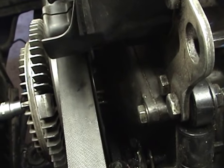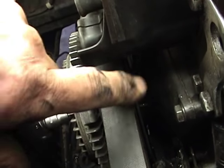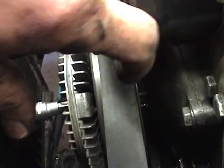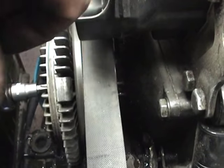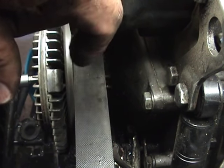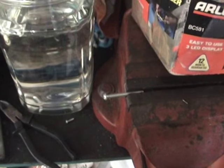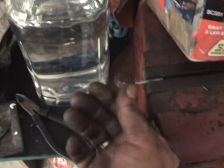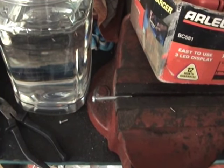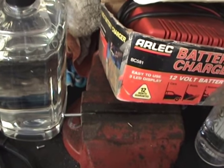Removing that pipe made it a bit easier to see. You can see there's a slot there, and on the inside of the pulley there's a hole. If you lean right over you can see it and you can line that hole up with that slot. What we're going to do is get a 4mm diameter screw and try and drop it in the slot and slide it in the hole to lock the clutch. Get a 4mm diameter screw, cut it about 15mm. I've already tried a few times and dropped them around the engine, but I'll cut this one and we'll try again.